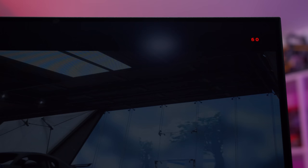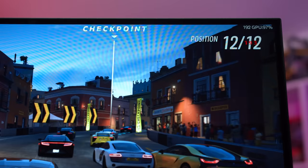When enabled, the refresh rate readout will show the current frame rate on the display as reported by the monitor itself. If variable refresh rate is working correctly in the game — provided your in-game frame rate is below your monitor's maximum refresh rate, for example 100 FPS on a 144Hz monitor — this on-screen refresh rate counter should be varying and roughly matching your current in-game frame rate.